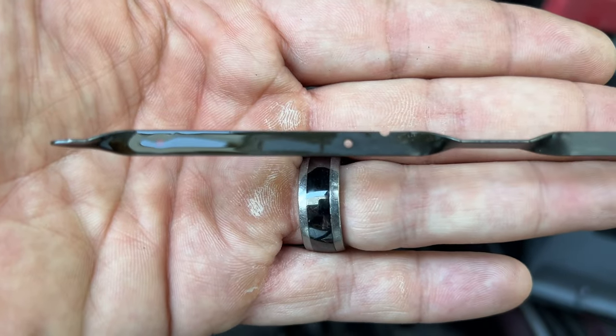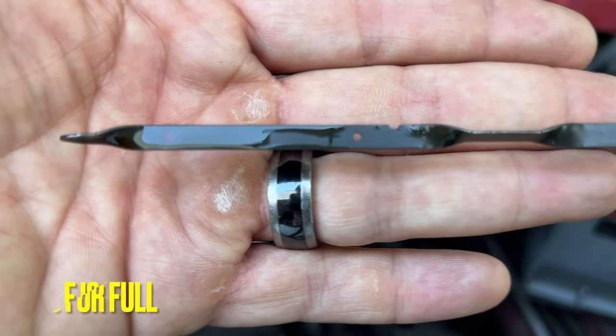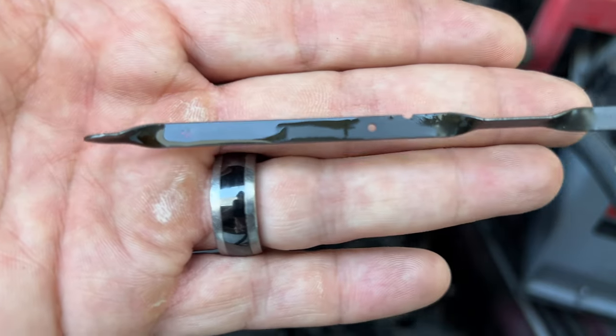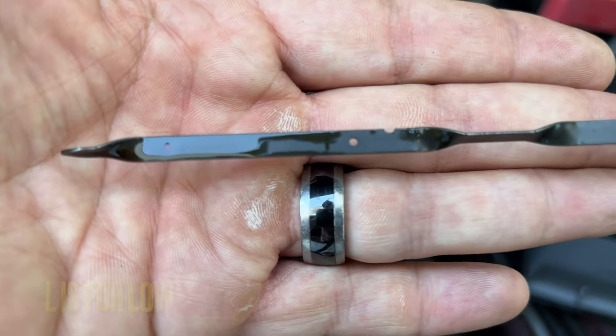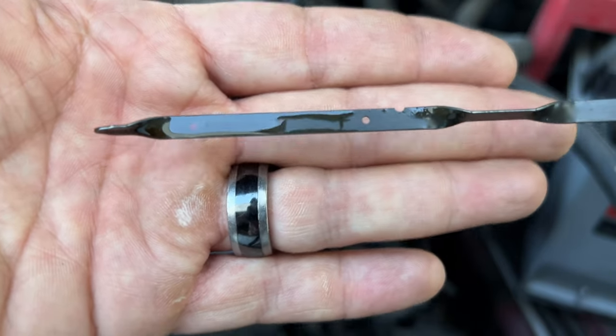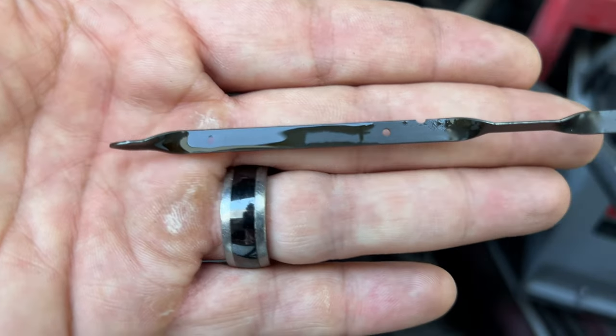Look here — where my wedding ring is there's an 'F', and then down here where this other circle is, that's the 'L'. Ideally you want to see your oil in between the F and the L. Right where we're seeing it here — right in between — is ideal.